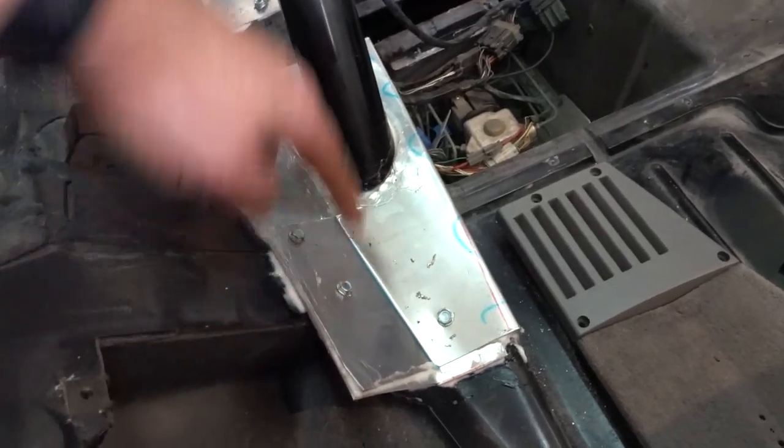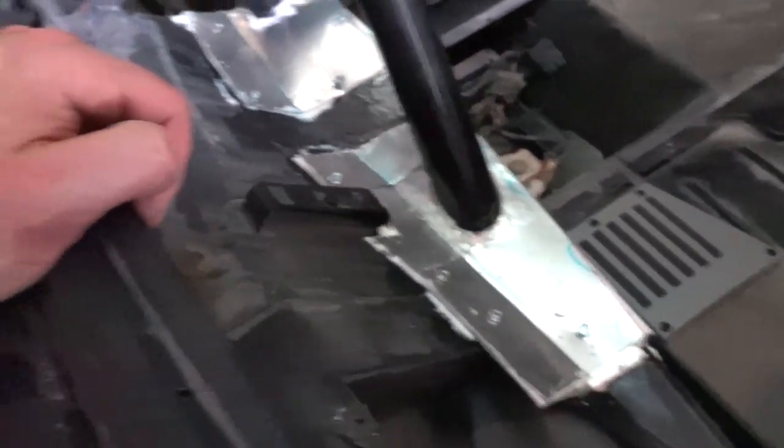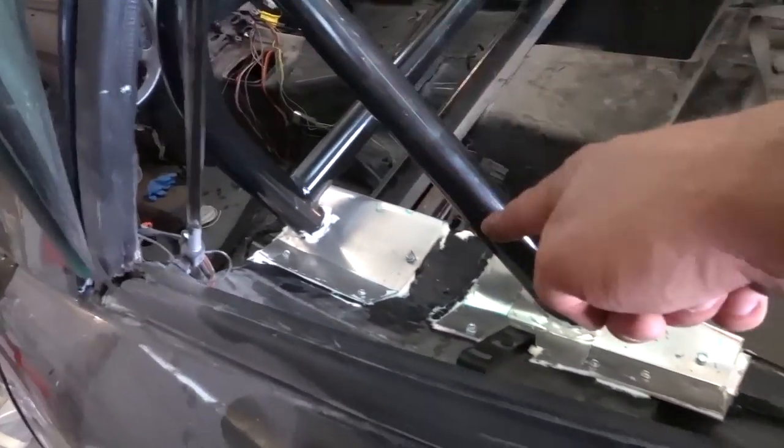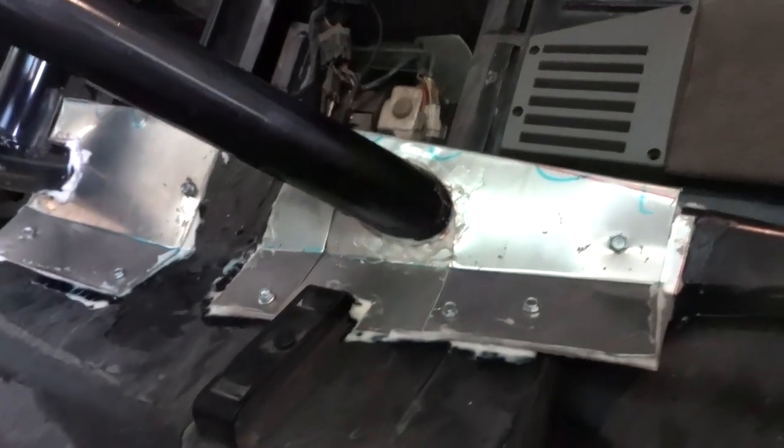We have these sheet metal screws down here going into the fiberglass and the metal underneath to hold that on. And then it's all caulked around the edges because, as you know, that goes straight to the frame. The frame is not sealed. I figured if we ever hit any big puddles, it's gonna shoot water straight up into there and get our carpet wet. Or bugs or animals could crawl up in there. And so it's all sealed now with that silicone.